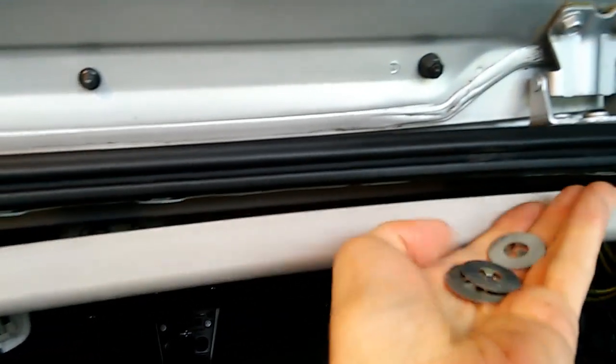Now on this roof section, after removing this pillar, I've got a little bit more room, and there are 3 clips, 1, 2, and 3, which I was able to pop down. Also, there's this separate piece of plastic here, which is held on by these little guys. And I went ahead and removed those. I'm not sure that's the right thing to do or not, but I'm trying to get enough room to work here without pulling down everything. So I'm going to see if I can get that room by simply pulling this one strip off. I've loosened up everything here, and let's see what we got. Got that piece. I hope I can get that back on again.